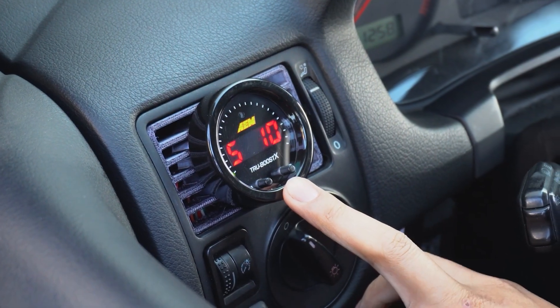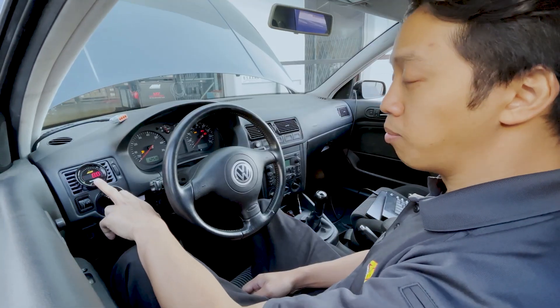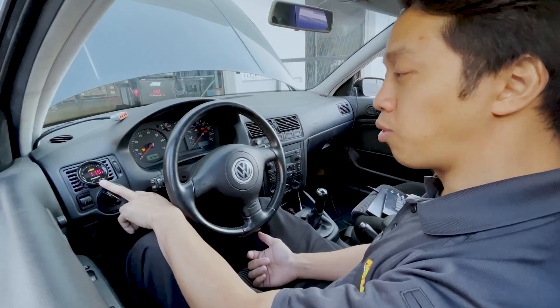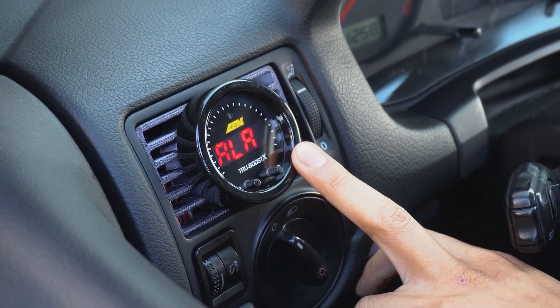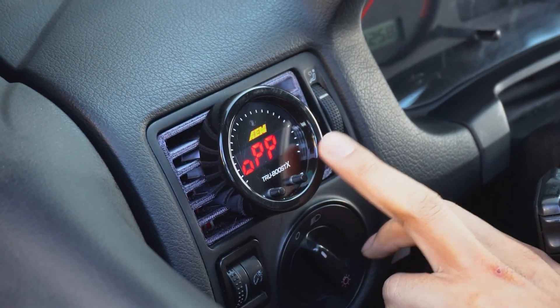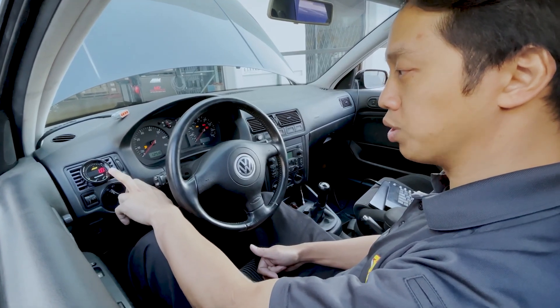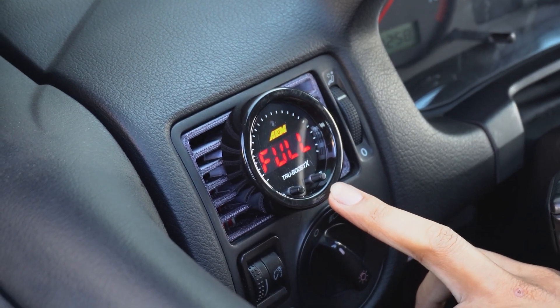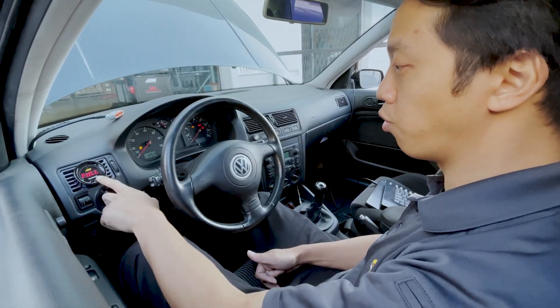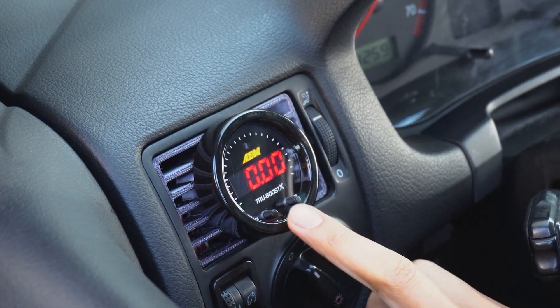Next is the scramble boost setting — this sets the duty cycle for scramble boost mode; we'll leave this on 10. Next is scramble boost time, which sets the time factor for scramble boost; we'll leave this on zero for now. Next is the alarm setting. Since this vehicle will be targeting around 10 pounds of boost, we'll set the alarm at 11 — if we ever hit over 11 pounds for longer than one second, it will cut boost instantly. Next is open pressure — we don't know the current value, so we'll use our peak recall function to find out and set this up afterwards. Full scale sets your LED segment — since this vehicle runs around 10 pounds, I'll set this around double that so our typical boost value appears in the middle of the LED sweep. And lastly, this sets our A and B duty cycle settings and run mode.